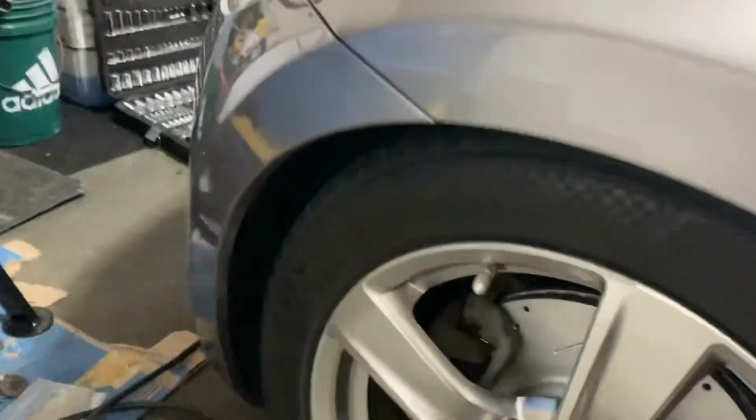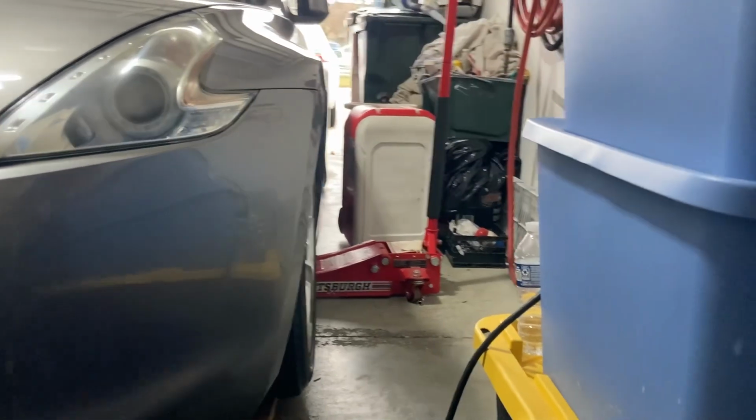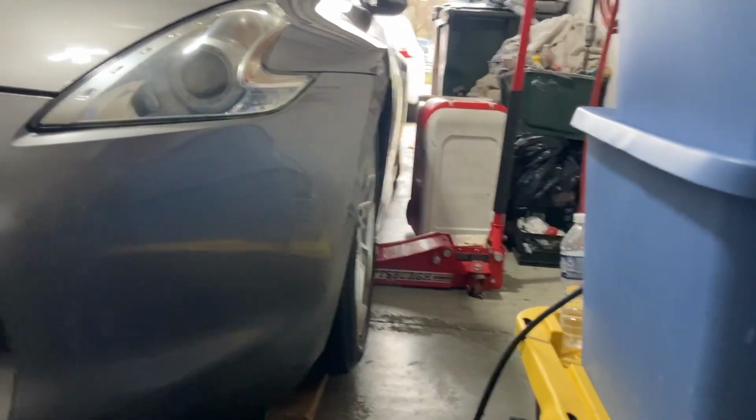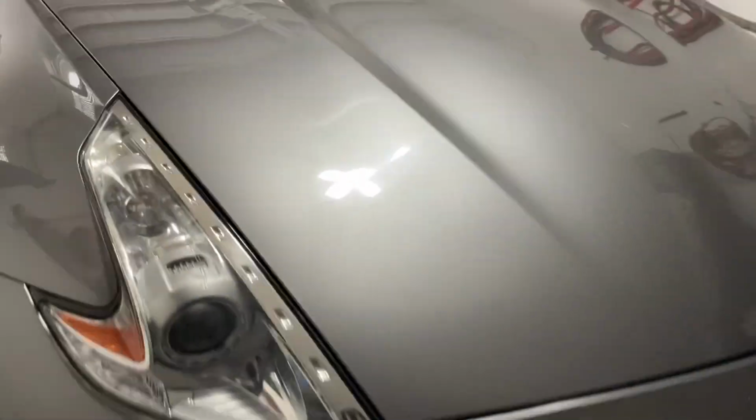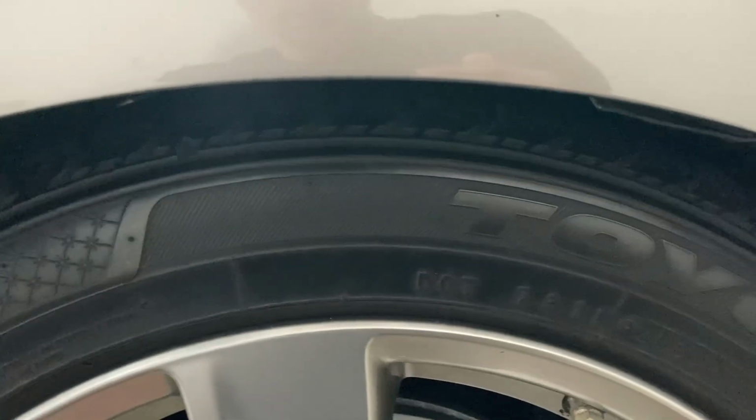All right. After a bunch of up and down on both sides, we got both wheels basically the same height and same amount of camber. It's sitting around -1 to -2 degrees of camber right now. It's kind of hard to pull it all the way out. I got them both very close. So that's where I'm gonna probably just leave them for now. And see that there's a shit ton less camber and it's a lot taller. So both of them, the tread is just under the fender.